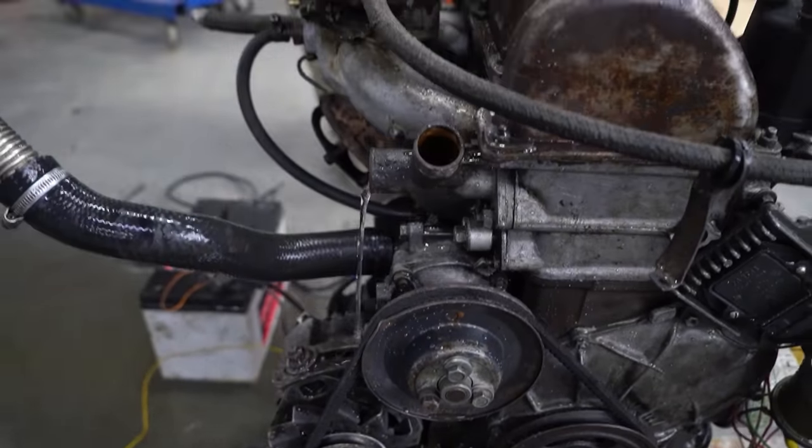What, we didn't mark this one? This is number two. Okay, now it all makes sense. Here I have one and four. You can see that these rings are a bit twisted, and that's what must have caused... Well, you saw those flames coming from the headers, and you could tell that cylinders 2 and 3 were operating stably, while 1 and 4 only really fired high up in the rev range. Yeah, it's all because of the twisted rings. What's funny is that... Well...